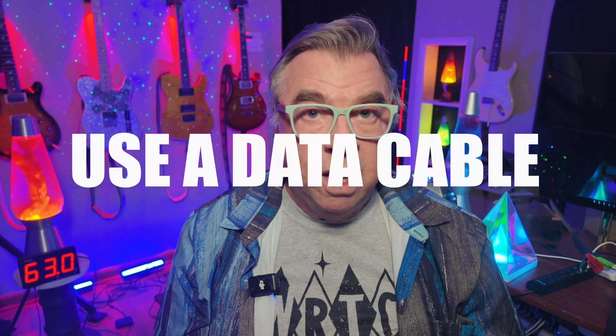But what if that doesn't change anything, what if you're still having the problem? Well, the next thing you should try is another USB cable, preferably a new one. If there is a cable involved, 9 times out of 10 the problem was with the cable. Most people say, 'but that cable was just working a little while ago.' Well, cables do not have a predetermined lifespan — they will quit at the most inopportune moments. So try replacing the cable. And make sure that it's a data cable, not just a charging cable. A charging cable will not work between the ToneMaster Pro and your computer.